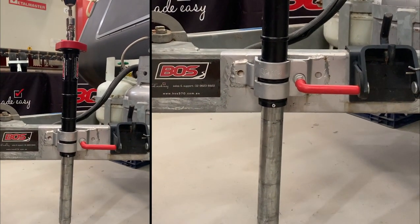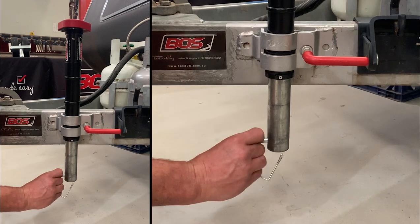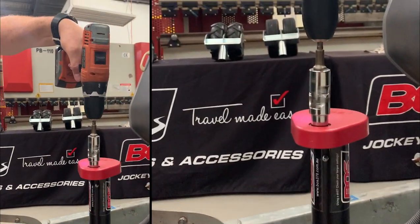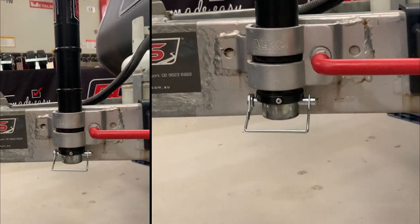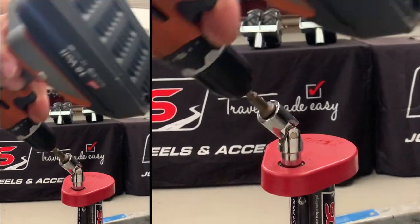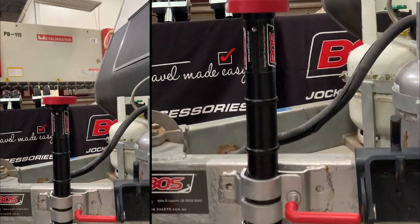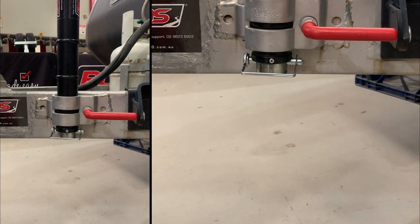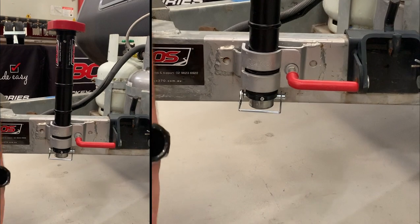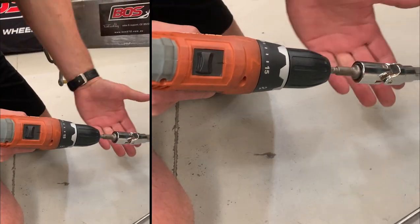The other thing is that people do forget to use the clutch when winding up. We're going to demonstrate the opposite: wind it up very fast, put the pin in — doing everything we've explained — but forgetting to put the clutch on. Winding it in, what can happen is the drill can click and kick and hurt your wrist. That's why we always say use the clutch. Now we've locked it up and we have to undo it again. Up means the unit comes out, so we want it to come out because we just rammed it in. Use drill mode or heavy clutch setting, slow speed with more torque, and change the direction.